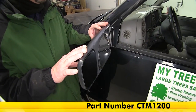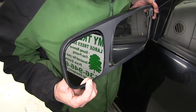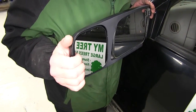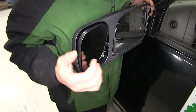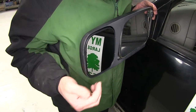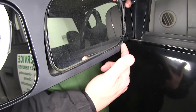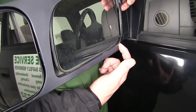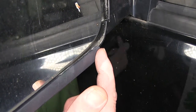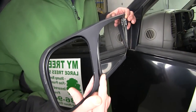To begin our install here on the driver's side, we already have our mirror in place. Our extended mirror is fully adjustable, so the manual mirror on the outside will go down, up, out, and in as necessary to view your towing product. Along the back edge, closest to the manufacturer's mirror opening, you can see where the outer edge hooks around the lip of the mirror to help hold it in place. Additionally, it still leaves an opening for the manufacturer's mirror to be able to move around as needed.